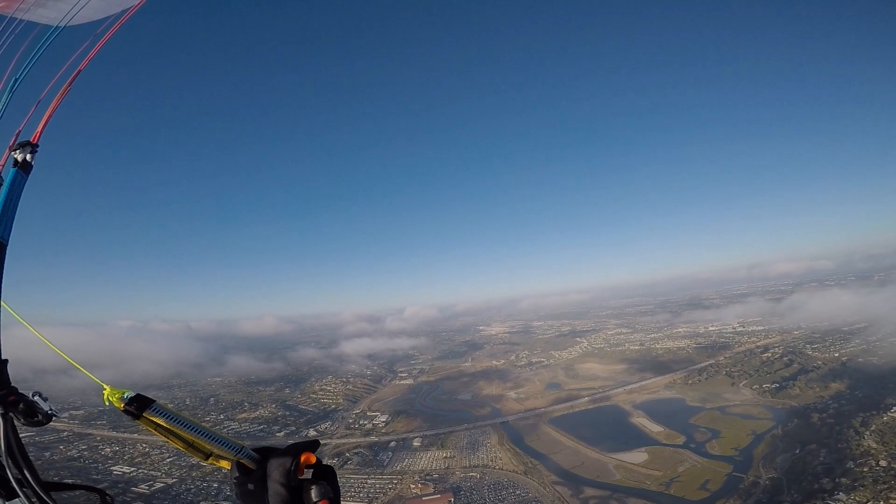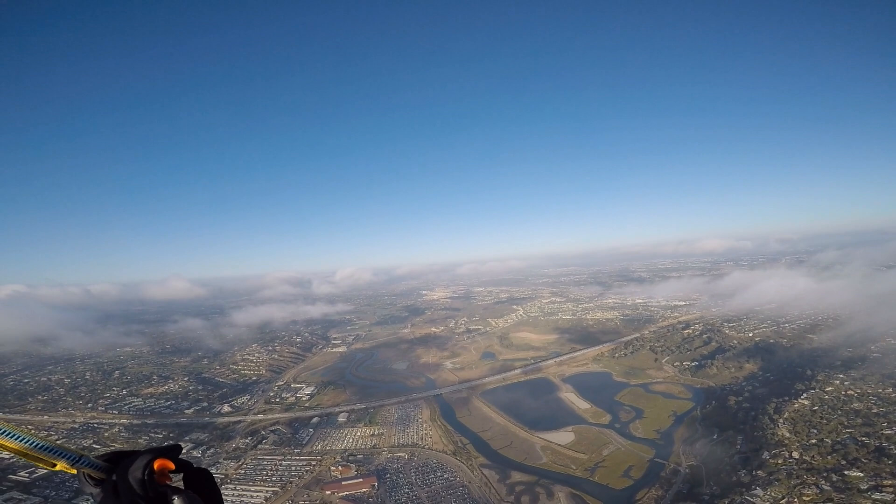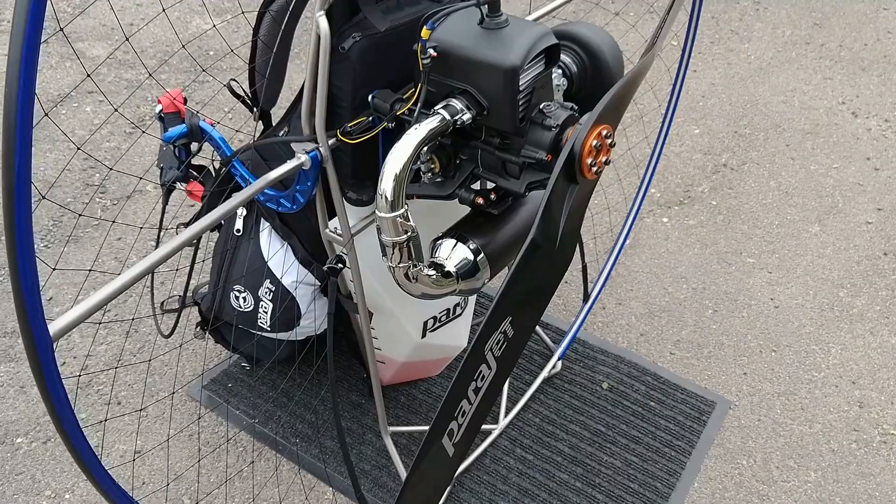Remember that I did get back in the air — this was a beautiful flight I had after I finally got that throttle on. Obviously the ignition coil is working again. Let's get back to how I solved this problem. Eventually, with some feedback from people with more experience than me, I decided we're just going to put a new ignition coil in.